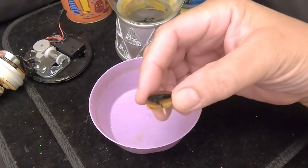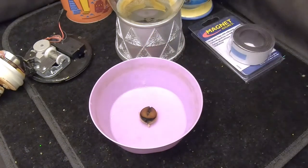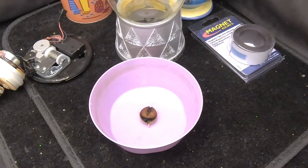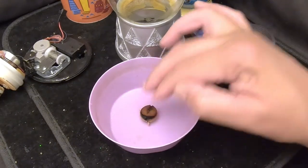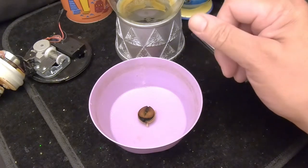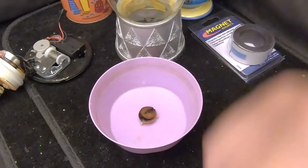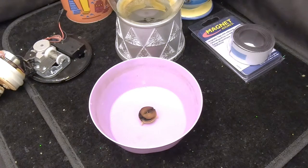We're going to take the impeller with the rusted magnet — which is basically just a big chunk of corrosion — and try to eat up that corrosion. We've always used distilled white vinegar for this, whether for an impeller or a rusty music box mechanism. However, a subscriber contacted us after seeing us use vinegar and said he had done a high school experiment dissolving corrosion with different solutions. Distilled white vinegar was one, but he said Coca-Cola worked even better.